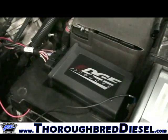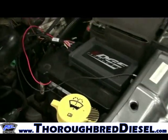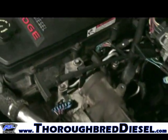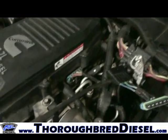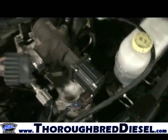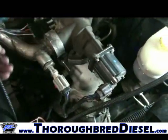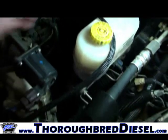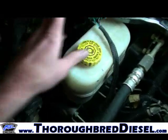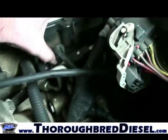After this connection, we're going to grab the injector groups. On the 2010, there are two connections: group one through three, and the back group four through six. On your juice wiring harness, there are two color code references. The red side group is for injectors one through three. The blue and green side of the jumper is for four through six. The one-through-three connector is the easiest to get to — that's this front side harness right here.